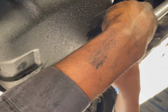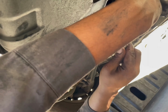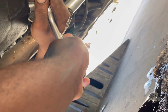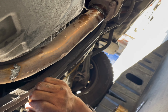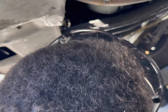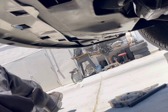Don't overtighten it, but just enough so that it's flush. You feel it? I want you to go ahead and feel how tight it is so you get the feel, but don't go tighter than that. That's actually as tight as you want, because you can strip the pan. Then you're gonna need a new pan or some kind of repair for the hole. So you do that. You get the filter. You need a new one. There's one inside the car.